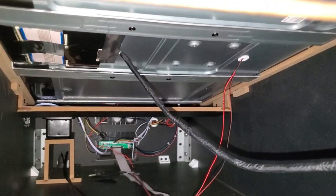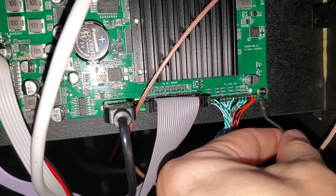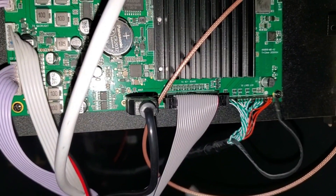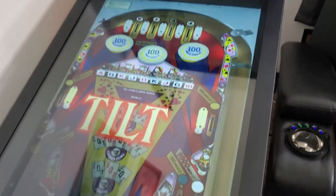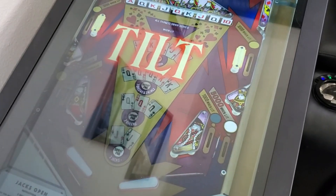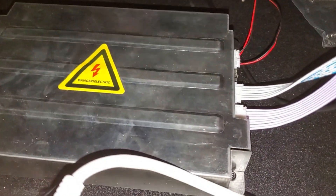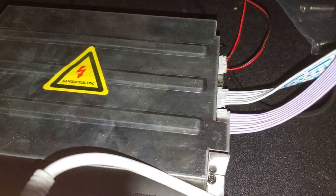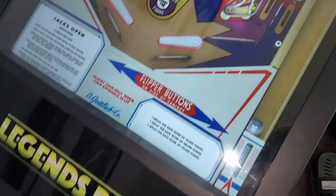If you have issues with your monitor or you're swapping out your monitor, you want to unplug the connections and unscrew it before pulling out your monitor, or else you'll damage the boards. Now, if you have a dark screen on the bottom or the top, or the whole thing is dark, I'm going to show you how to fix that. You want to check these red wires — make sure those connections are plugged in nice and secure, reseat them, and that should fix your issue.